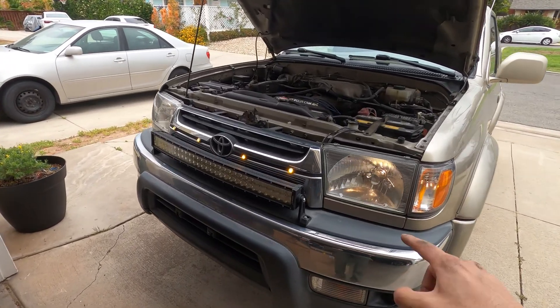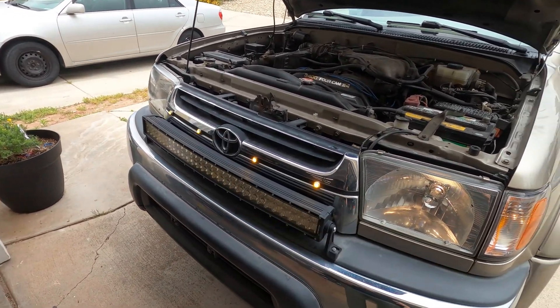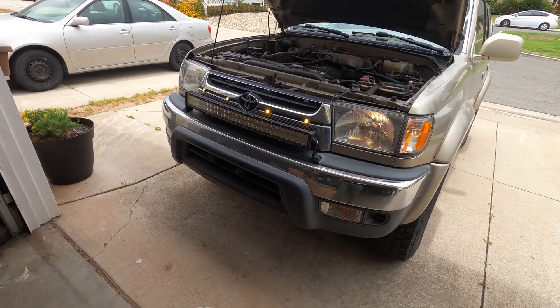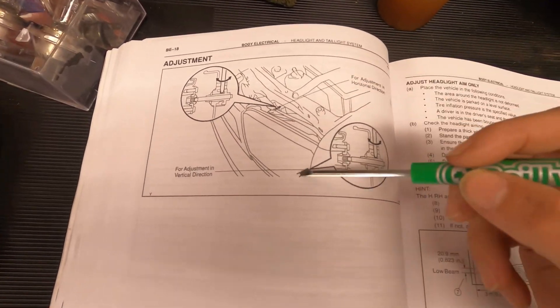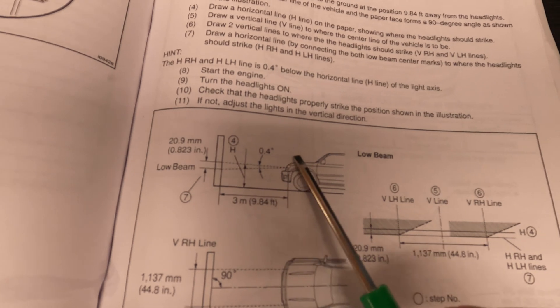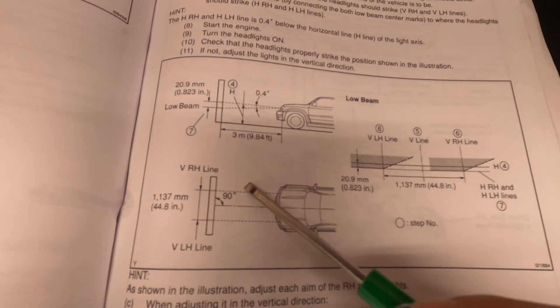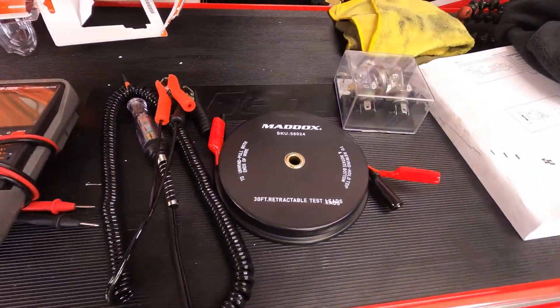Before you go and wrap this job up, note that anytime you change headlight bulbs, you do need to readjust them so that they're not aimed too low, too high, or too far left or right. You're going to have to find a good flat surface, do this at night, and your user manual should specify exactly how high or low those should be. You can see some headlight adjustment points here specifically on my car to adjust the headlight up, down, and side to side. The whole goal of this video was to teach you guys how not to be parts changers and how to diagnose things so you know how they work. This is not an all-inclusive video — I made this to be fast and efficient and something for the DIYer who's not a licensed mechanic to do at home. I hope you guys enjoyed the video. This is Anthony at DIY Auto Tech.